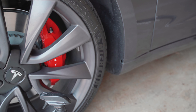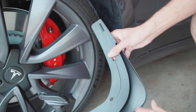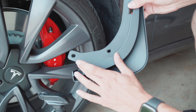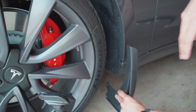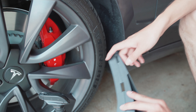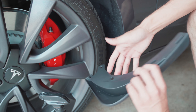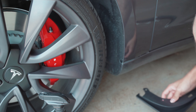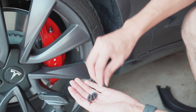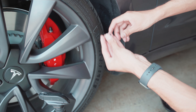We're here at the front of the car and we're going to start with the front mudflap on the driver's side. This is how the mudflaps are going to mount — they mount flush, as you can see. They have a plastic clip at the sides that clips onto the sides of the fender. We also have two plastic rivets that help to hold it down from the bottom. These are supplied with the kit that you can buy on Amazon — we'll have a link down in the description.